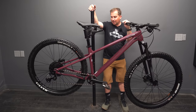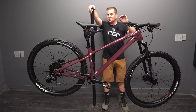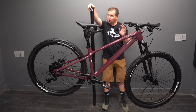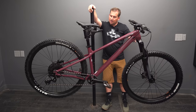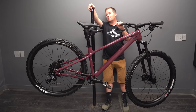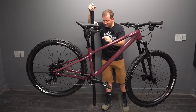So yeah, it came in fairly heavy, but for a sub $1,500 bike, we've got some really, really great things going on, and a couple things I think shouldn't be going on. I'll talk about those a little bit. This Habit 2 has a Cannondale bar and stem. We've got 165 mil cranks. That's probably the first hardtail I've seen coming out with 165 mil cranks, and I love seeing that.